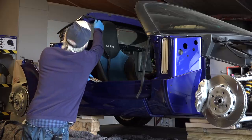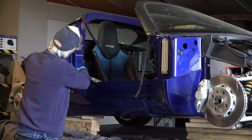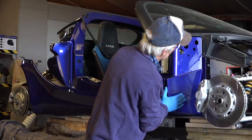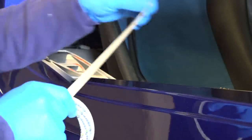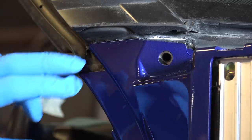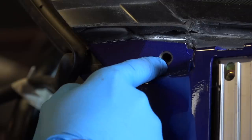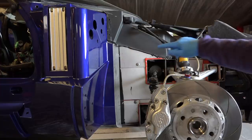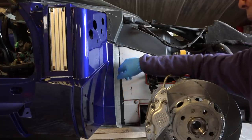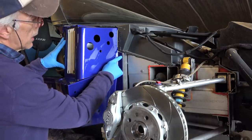I'm checking that everything fits properly all around, then putting a little bit of tape to hold it in place so it doesn't fall down. Trial fitting is very important because it has to fit precisely. This screw hole here is actually to mount the front clamshell, so you've got to make sure it's properly aligned to that hole. I'm using masking tape to mark the edge of the new sill, because otherwise you might miss the placement.